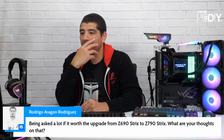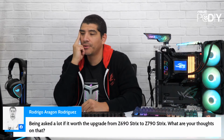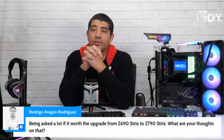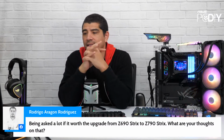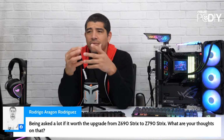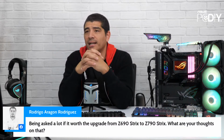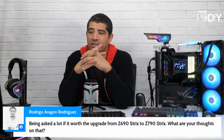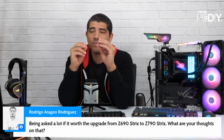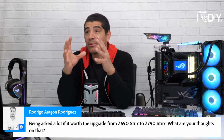Somebody's asking right here, being asked a lot, if it's worth the upgrade from Z690 Strix to a Z790 Strix. So what are your thoughts? No, I don't think you actually should upgrade. The Z690 and the Z790 boards are effectively the same. There's, of course, a technical difference in terms of the chipset. There's also a little bit of a difference in terms of the PCB design and the signal integrity optimization. Z790 actually has a superior level of signal integrity, and this helps to aid in terms of DDR5 memory scaling.